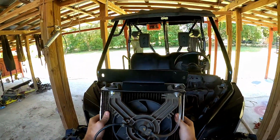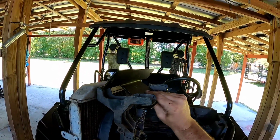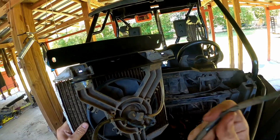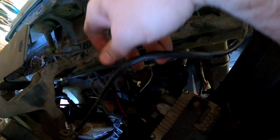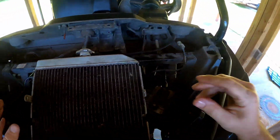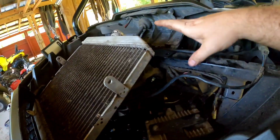Next thing we're gonna do, take our radiator assembly. Let me set this down easy here. With the bracket already installed up here with the grommet, that's tight. I've got my vent line run, you want to make sure that's connected. Your electric fan motor is right here. Pick it up, we're gonna drop it into the grommet, and it sits down just like that. Wow, awesome, very cool.